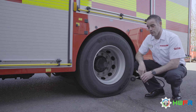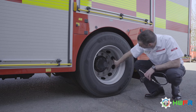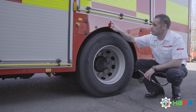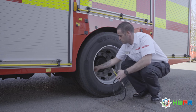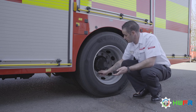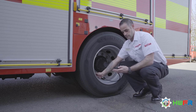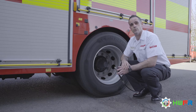We've got two pressure valves — one down here for the inside tyre and one up here for the outer one. The tyre pressures are written above each wheel. Unscrew the cap first and attach the gauge — try not to lose the caps. We need to do this when the tyres are cold because air expands when warm and will give an inaccurate reading. That's at 95, which is exactly what it needs to be.